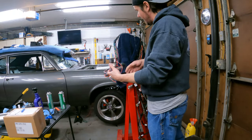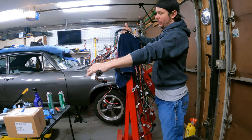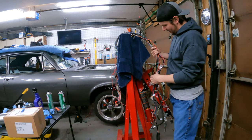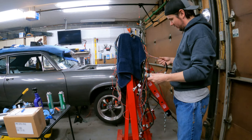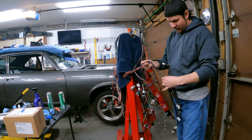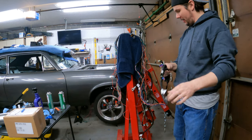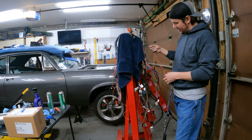I've got most of the harness unwrapped and found where I think is our termination point for the new one. We're wanting to remove about three feet of harness. A couple of the endpoints here I want to extend — specifically the coil connectors. The problem is they're just so tangled up with other sensors. This harness is a mess. It really didn't isolate much, short of maybe the IAC, TPS, fuel pressure, coolant temp sensor, and manifold air temp. That's a nice section to go out front. I'll probably cut this one back a ways.